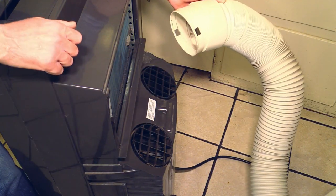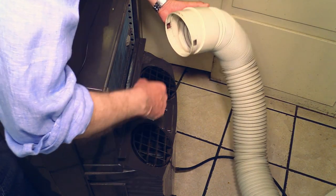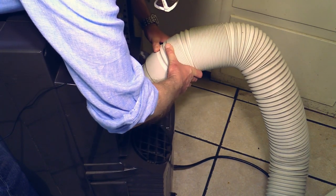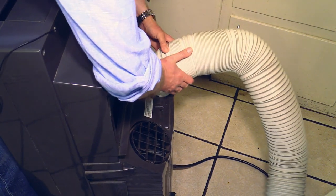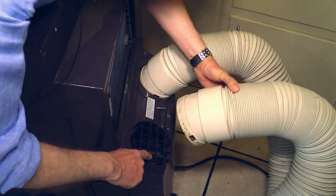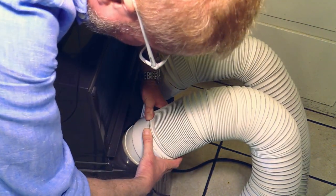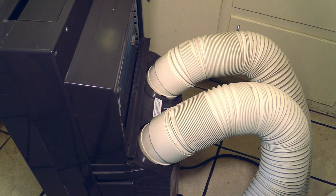Putting them back together again: here are two plastic prongs, and you have to line up those holes with these plastic prongs in order to make it click in. So now we are lining it up — have you heard the double click? That's it. It must double-click, then it is stable and will not move. Let's do the other one — again line it up with these notches, move in a little bit, line up the hole, and there's that. This is all you need to get the hoses on and off.